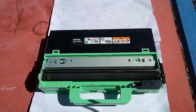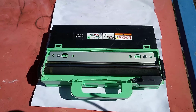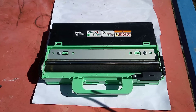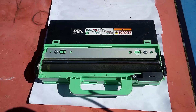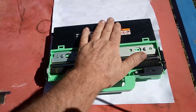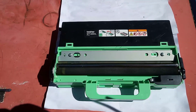Hello and welcome to today's video. Today's video is about the Brother MFC-L9330, the 9340, the Brother HL-3170, HL-3150, and the message 'Replace WT Box' or 'Replace WT Box Soon.' These machines have developed a problem where they give you a false message saying replace the WT box. I've come across several customers recently who have replaced this box four or five times over 12 months before they twigged — hang on, why am I changing this waste box five times when I've only replaced the toners once?